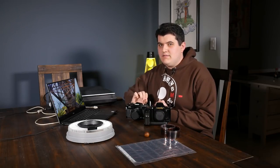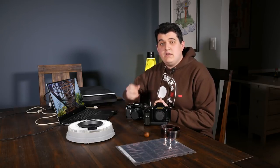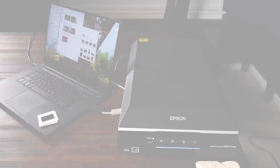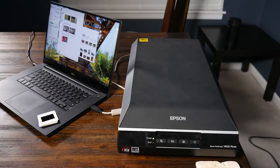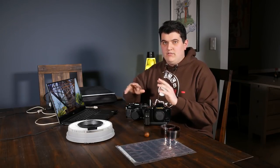Now to the fun part. When you use digital ice, the scanner actually scans each negative or slide twice. You'll hear it get into position, make one pass of a scan, and then the backlight and scanning head return to their parked position. But right when they stop, you hear a click. That click is the light source switching from your standard issue white light to infrared.